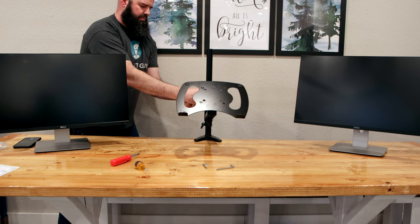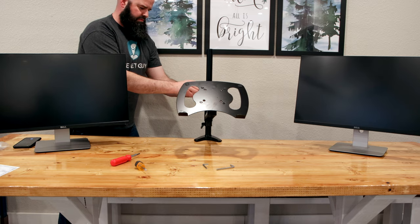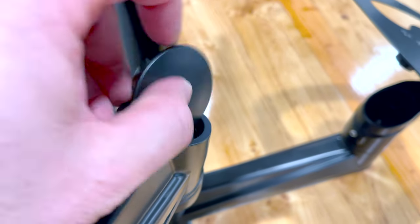Next, the small tray arm slides on, then the collar, and the double monitor mount slides on after that. Carefully mount the two monitor arms, and be sure to use the included square plastic arm locking screws once you have things situated, so you don't accidentally remove the arm when you're just trying to adjust it.